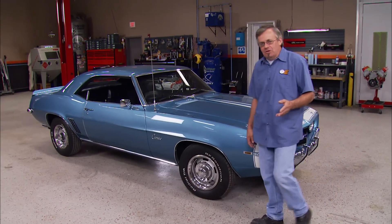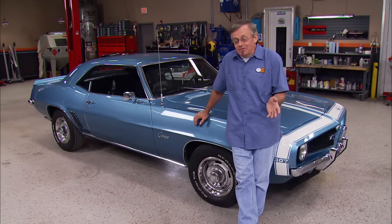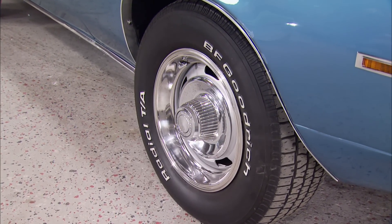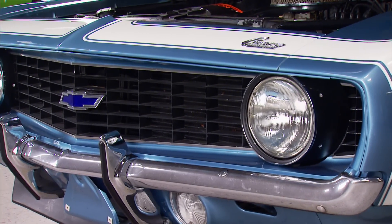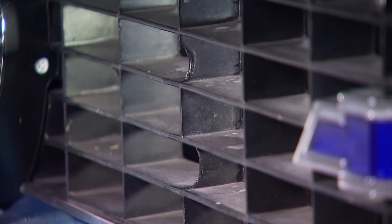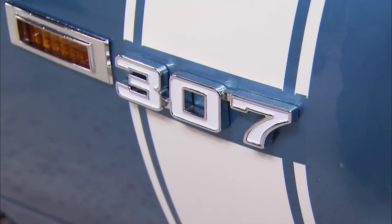Tommy spent a lot of time and energy finding us a 69 for a COPO tribute car — and he found us a jewel. It's in really good shape, a baseline car, which means nobody's going to be upset if we tear it apart. Although the later COPO cars were offered with factory-style GM rally wheels, we're going to go for the more recognizable COPO look with plain steel wheels for a cleaner, meaner muscle car look. When it comes to plastic pieces — interior dash pieces and the front grille — we'll decide whether to replace or repair depending on damage and availability. The body trim and bright pieces will also get attention; the COPO cars came mostly as a baseline body without wheel opening moldings, the trim on the quarter louvers, drip rails, and engine badges — the 307 badges are definitely going.